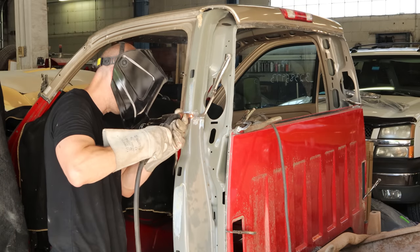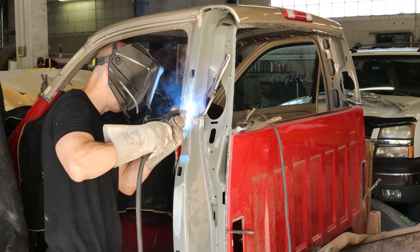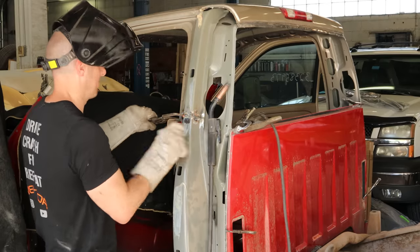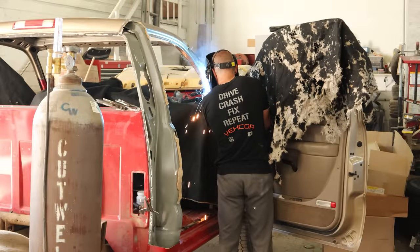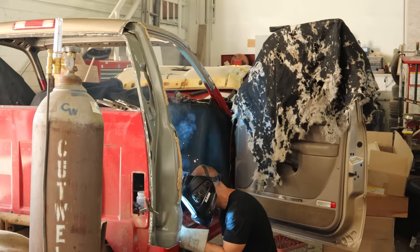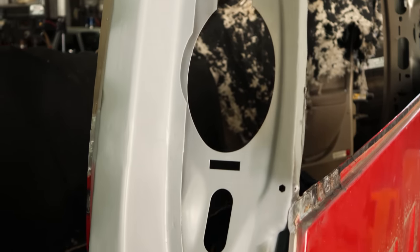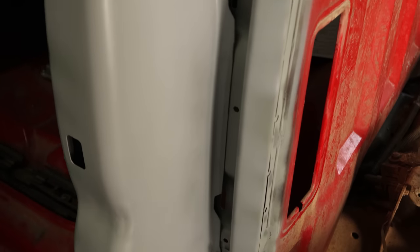Now we can start tacking everything up. We're going to weld our seams — just a little at a time so we don't get it too hot. Usually I just weld little spots and then move around. Move our clamps, then we'll weld up our pillar on the front. We're just going to tack everything in so it doesn't move — we don't have to worry about our measurements checking them over and over again. Once we've got a few welds in there, as long as we don't roll the truck over before we finish welding it, everything should stay in place. After we got done welding, I had the grinding gnome grind everything down, and then we primed everything up that we're never going to see again — that's hidden inside — so we don't have to worry about it rusting.